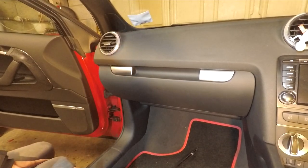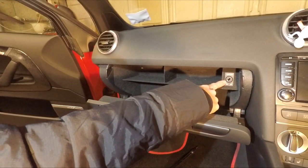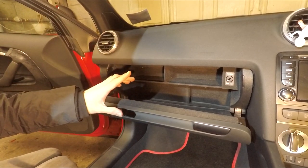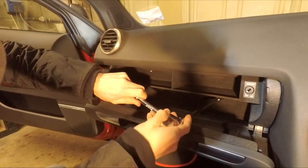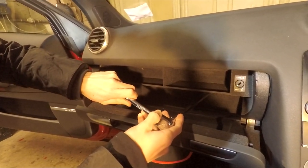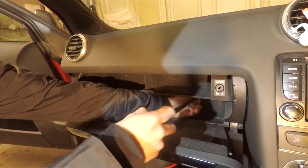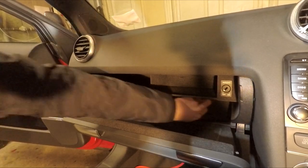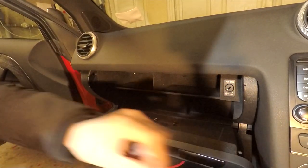The first thing you want to do is open up the glove box. I do recommend turning off your airbag while you're at it, just in case. Your first bolt to take out of the glove box will be right at the back here — it's an eight millimeter socket. Get your ratchet with an extension bar and just unscrew that back one. Keep all your nuts safe, put them to the side.